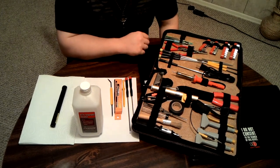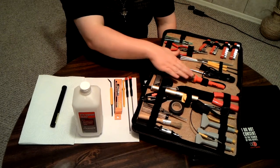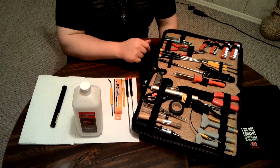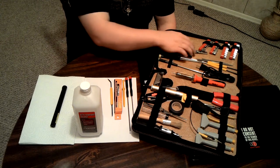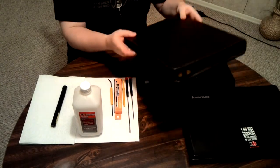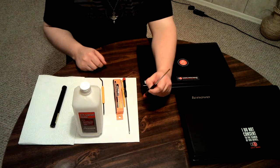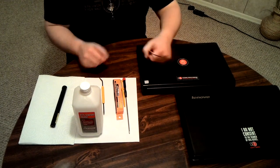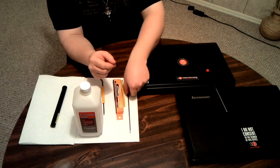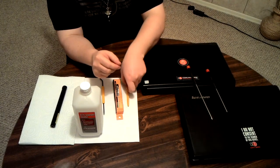However, pretty much everything else you might use, unless you're not doing soldering, then soldering stuff will not be used. This is a replacement soldering iron, just to let you know, because I liked the slightly warmer temperature of this one. But unless something goes wrong, you should not need any other tools other than what I have laying down there. These are just excess. Now, tools that you need are one medium-small screwdriver, mainly because there are some really small screws. One larger one for larger screws, because the smaller one will not pull them out correctly. You can strip out the screw.